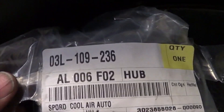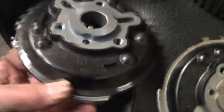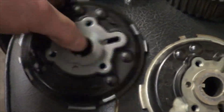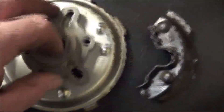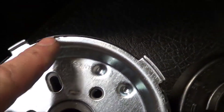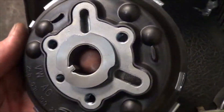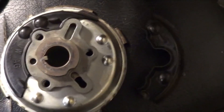And this is a replacement one. There's the part number if you need it. Here is, of course, what it should look like — part number is on this part, on the plastic part there also. I thought I could buy just the plastic part, but when I quoted the part, it was the whole pulley. I was very tempted to just throw this away and try it without that plastic — I have no idea what the plastic does. It kind of seems like it latches on right there; it might be glued in place also. We wanted to make it right — it wasn't an expensive part at about $89. But if you're doing a timing belt job on that, you might have to buy one of these pulleys to put it back together the way it's supposed to be.